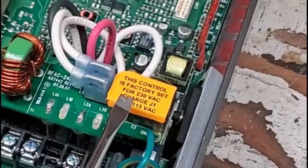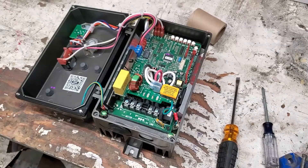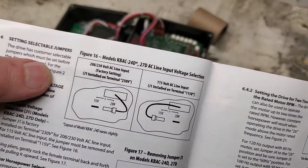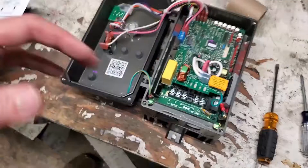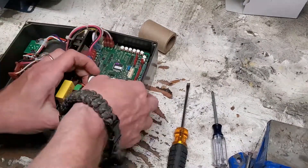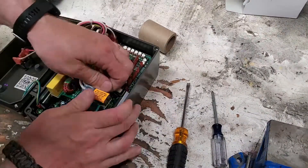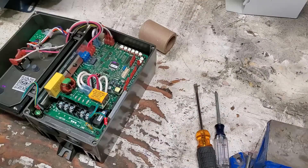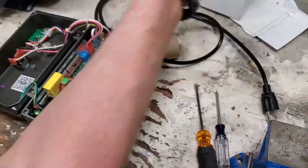I have to connect those two together and it's set for 230 volts from the factory, but I have to change it to 115 - basically 120. I'm using a regular outlet to run this and not one of the high power dryer-style outlets. That means I have to move this jumper over from the 230 to the 115 so it'll actually work right. It turned out to be a little bit more difficult than I expected - it's really on there good, so I had to use my Leatherman to pop it off and move it over. That's a really important step, otherwise nothing's going to work right.